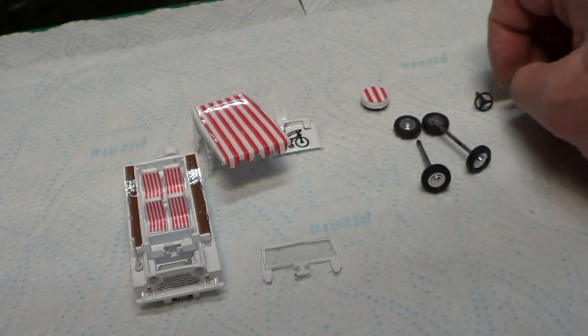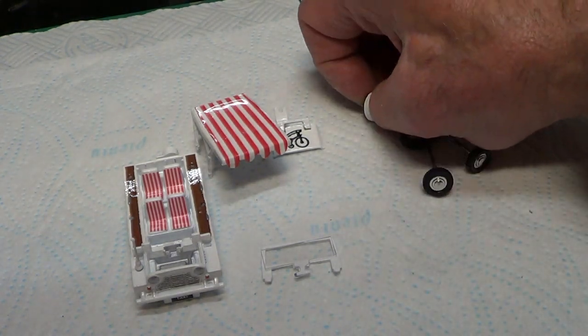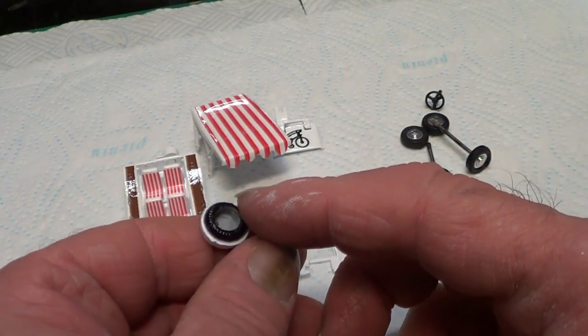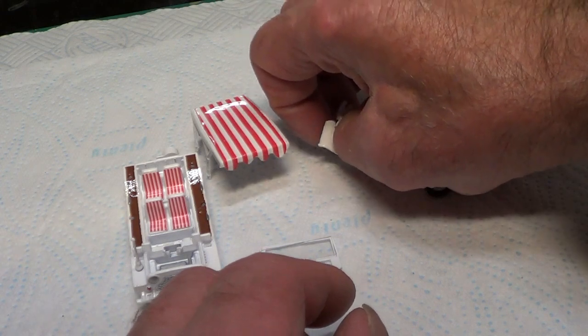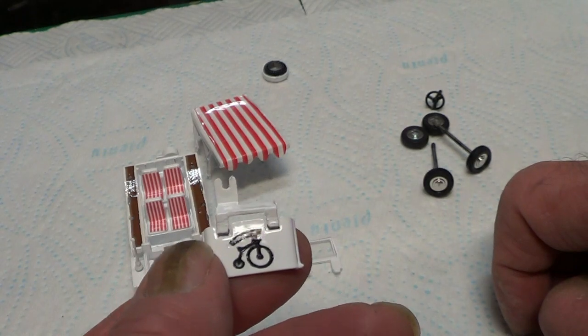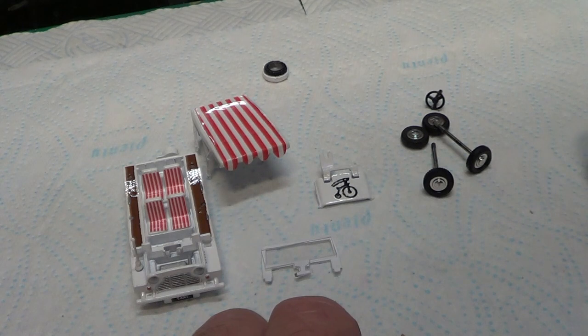So again, I've got a reproduction steering wheel. Put stripes on the back wheel cover, painted the tyre in and lacquered it. So hopefully that should be all right. And then we've got our water slide decal, a homemade one I put on the bonnet, and then I've lacquered it. So we're ready to put back together. Okay then.